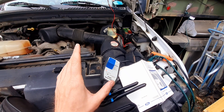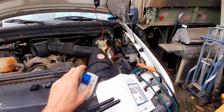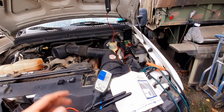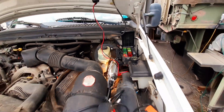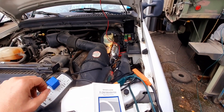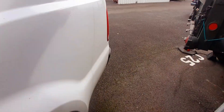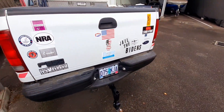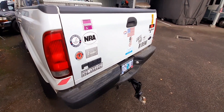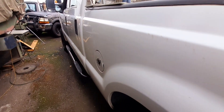Always make sure there isn't a section of the vehicle where you haven't seen all the fuses. Then we start getting into fusible links, which is another story for another day. Always check to make sure you've got every relay located. We don't have any rust or anything so I wouldn't think there'd be corrosion, but always check — this relay is the cause of problems for a lot of these trucks. Anyway guys, hopefully this helps. If you have any questions, concerns, or comments, let me know.